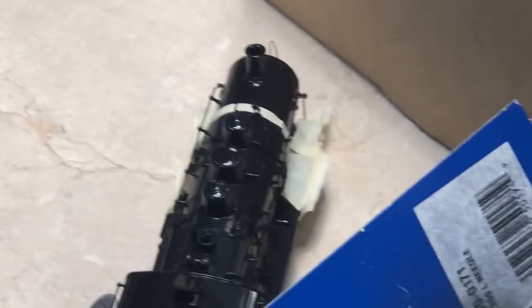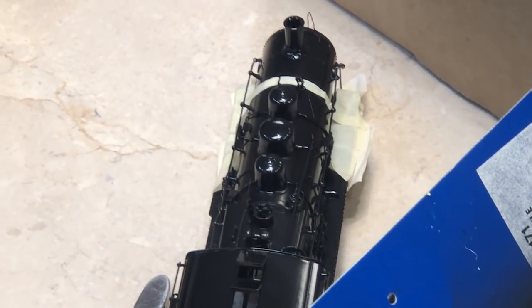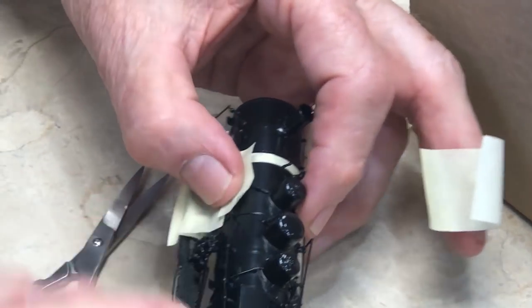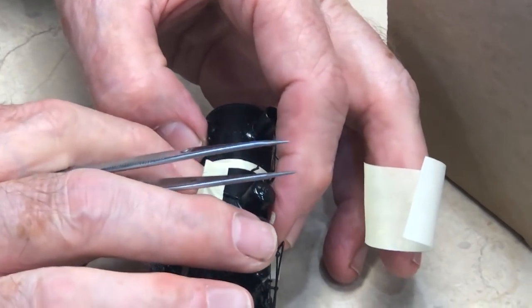And so you never have any residue of the glue left over from the tape. If you get some bad tape, you will, but xylene will clean it off. Xylene? Okay. Or naphtha, use naphtha. And when I shoot this, I always come from this direction, so it never gets up under that tape. That's right.